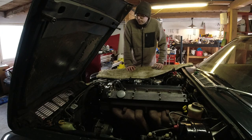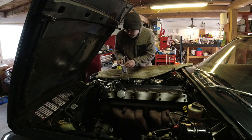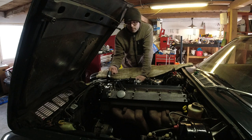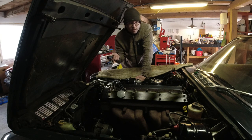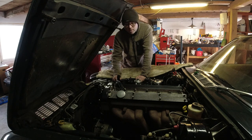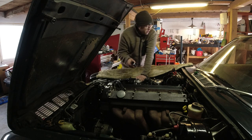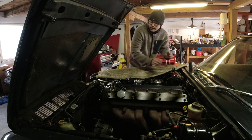Got all drained out now — one bathroom trip later. So this is the hose. I reused my old one when I replaced this engine, because I reused the water pump from the old engine, and I think I must have nicked it up or something when I put it in. Because it doesn't matter how I tighten it up, it always weeps a little bit. It doesn't leak when the engine is hot, it doesn't leak when it's cold — it leaks during the warm-up and cool-down periods. So it leaves a drop or so on the ground, but never enough that I really have to refill it with coolant. That's why I let it go for so long.